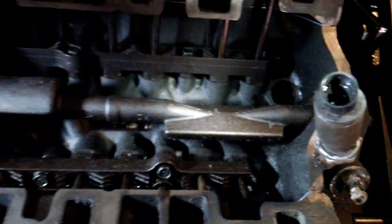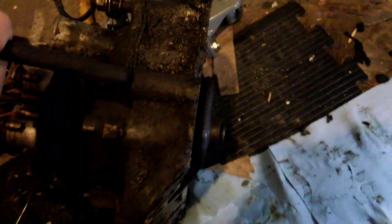This far back it'll just slap right on, no problem. Right here though you've got an issue. See this bung down here? It's got a half-inch pipe plug here — three-eighths drive on it. That creates a mounting issue, about that depth of mounting issue to mount it into the intake.